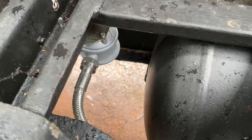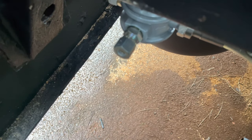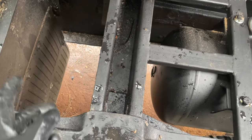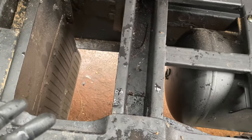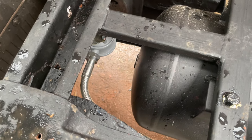The final resting position for our gas regulator is going to be under here. I've removed the shield temporarily, but I know it's going to fit once the floor's back in. The outlet for our 8mm gas pipe comes out here. Once the floor's back in I'm going to run that pipe neatly up underneath the floor and out to where I'll have my gas isolating valve inside the vehicle. For now this is nice and secure, ready for the floor to go back in, and once it has I can run the gas pipe and put the shield back on to protect it from stones.